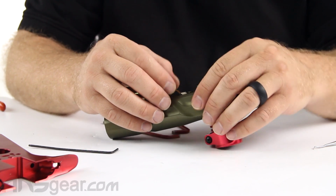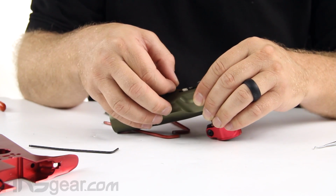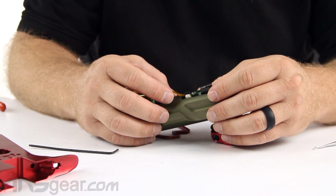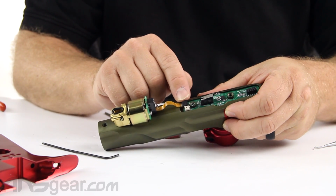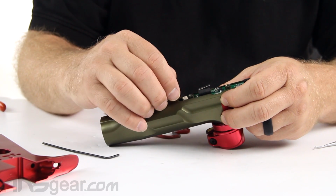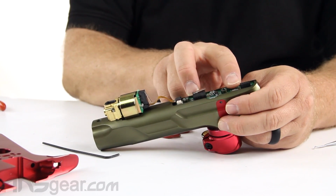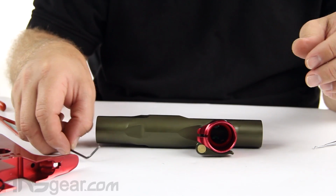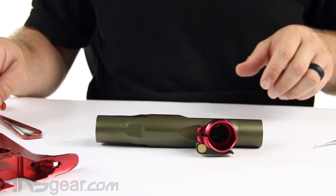And let's connect our cable. Now this, you want to be careful with. We don't want to bend or crimp this piece by pushing like this. We've got to push this wire into this block right here. It's a ribbon, so it's thin, and we don't want to push so hard that it bends over and crimps itself. So you want to grab it as close to the front as possible and try to slide it in there. If we can't get it to go together, we can always pull the whole board out and connect it that way, which we might have to do because we're going to pull this out anyway. And we're going to pull the eyes out. The eyes will be our last little stop here on this journey.